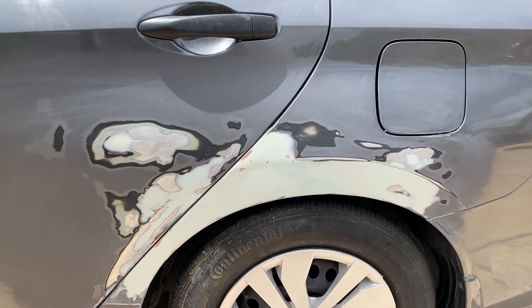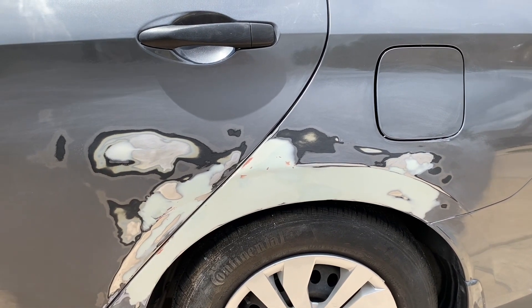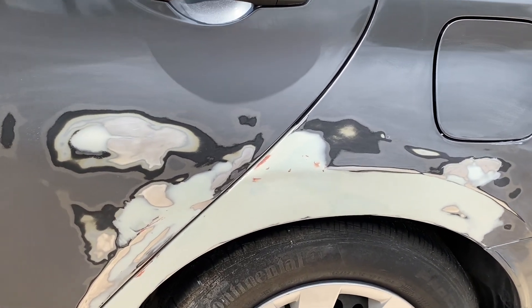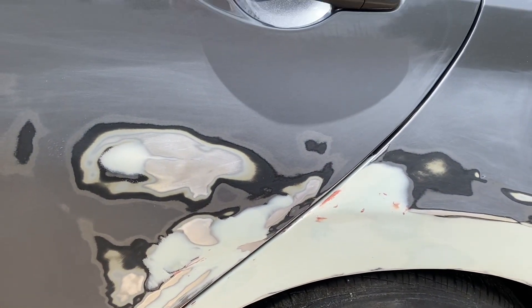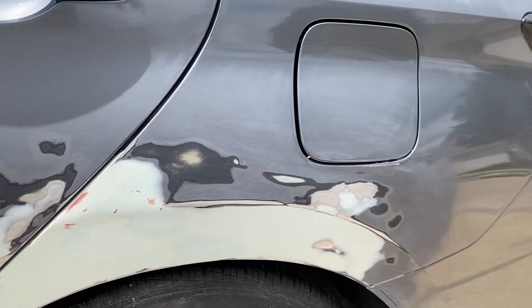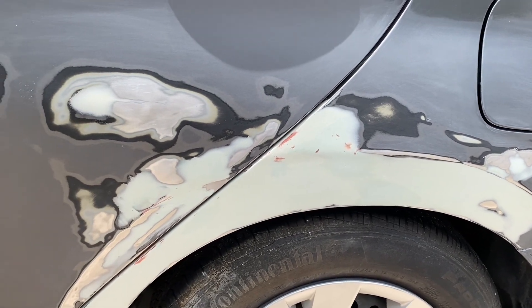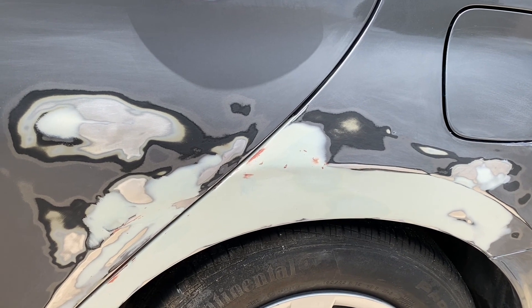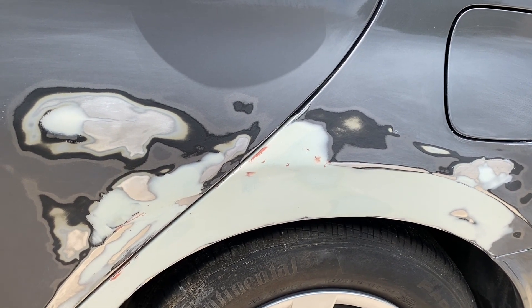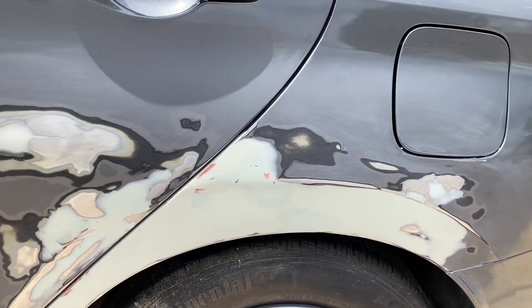My first job ever — I did some body work with my brother back in the day, but that was so long ago and I don't know much about body work. I built this back up. It was all crushed in. I took out the crease that was up in there, took out the crease in the back, and tried to get all the wrinkles out of that metal the best I could. I didn't have professional tools — just a basic hammer, a dolly, some glue pulls, and even some PDR bars for paintless dent repair to try to get some of the wrinkles out. I tried to get that wrinkle right there — I did not get it.